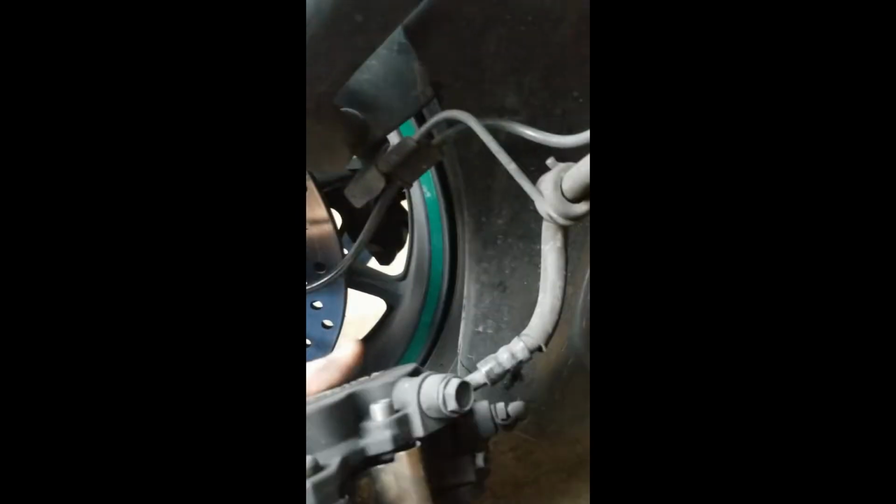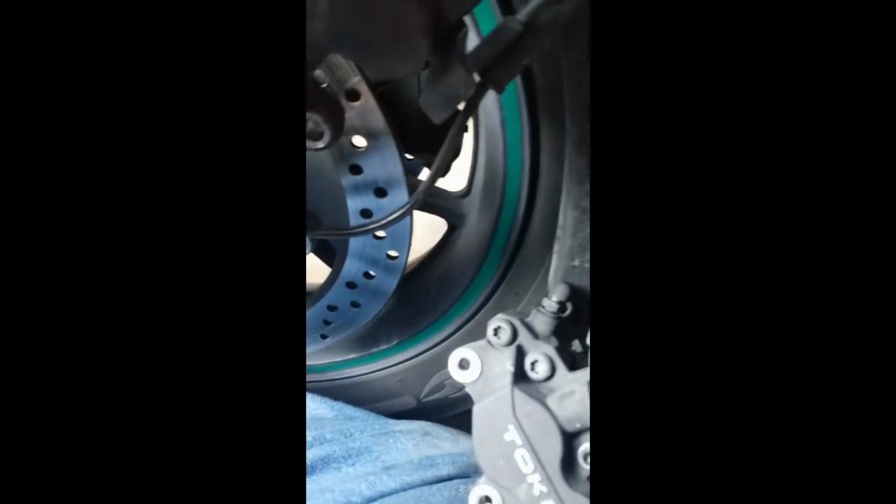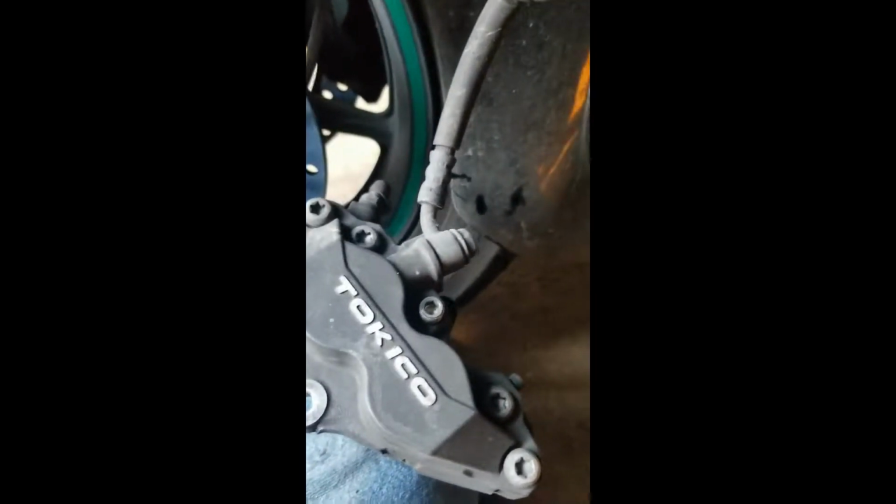Caliper fall out. Well, you might have to pull it a little bit. And there are the two spring screws right there and right there. You will use a 3mm to loosen these up, and that's going to make putting the new pads in easier. So you can go ahead and take out the pad retaining screw.